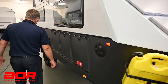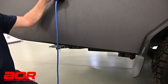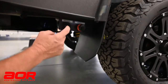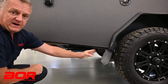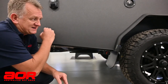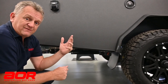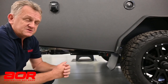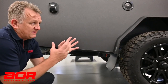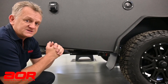The other option is up the side of the trailer here. Each of these fittings are labelled — this one here says 'toilet flush' and 'grey flush', so we're talking about this fitting here. We connect our hose onto there and what this does is flush the line from this point back down to our black water tank. You don't have to do it every time — every two, three, or four tanks, whatever suits depending on your usage. We're cleaning the line at the front, cleaning the lines down into the tank.